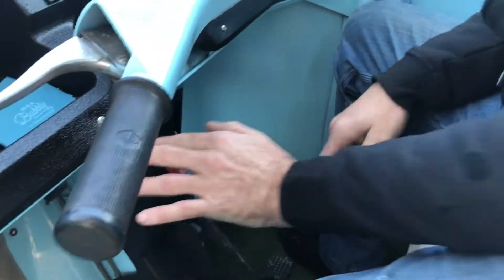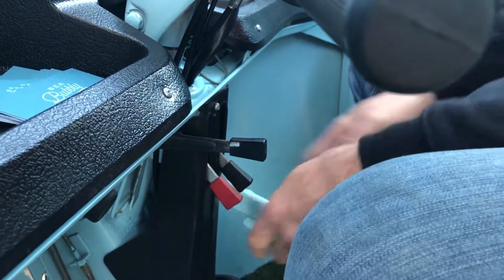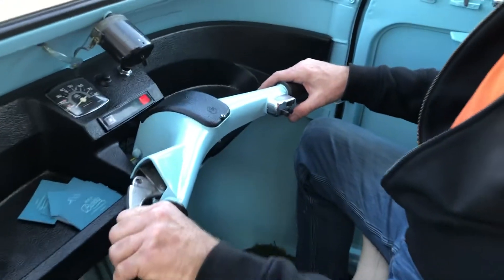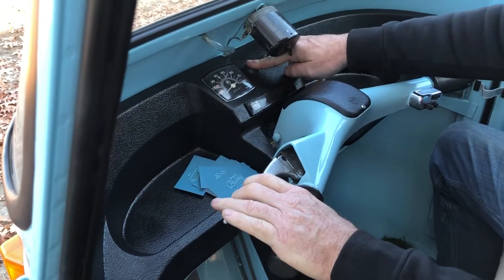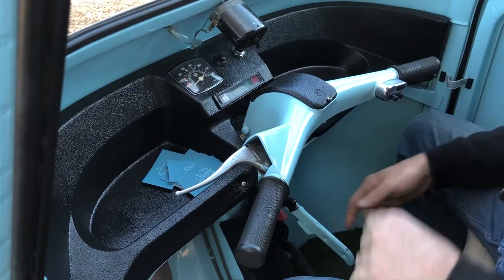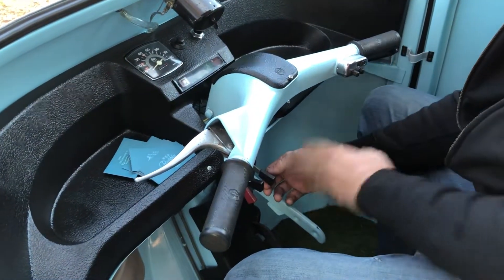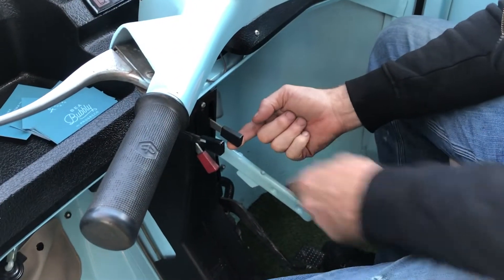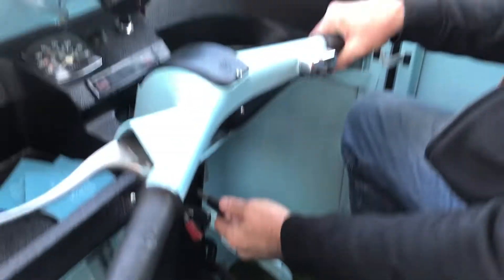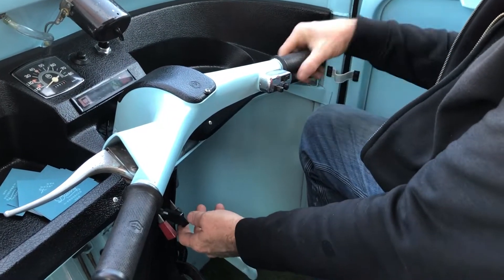This is your parking brake. The first lever on the left is reverse. This is for your heat, and this is for your choke. When you're ready to start, make sure the vehicle's in neutral. The best way to check is to hit the starter button, let the clutch out a little bit, and make sure it's not lurching forward. We didn't need much choke — this bike doesn't require a ton of choke to get it going, but you just hold that lever up.